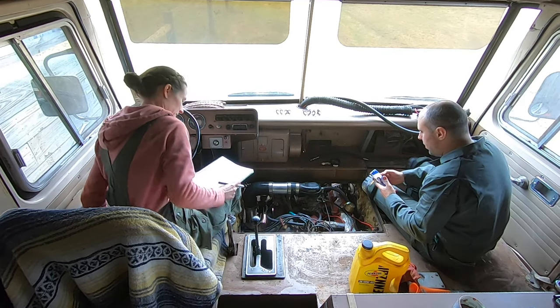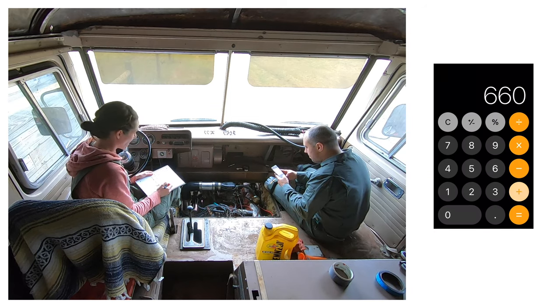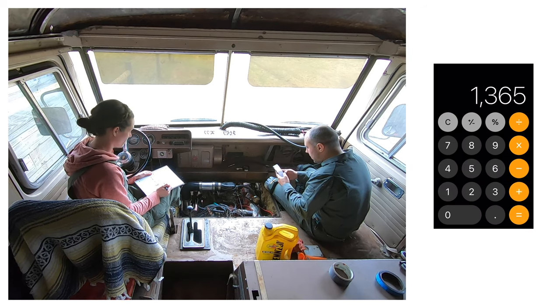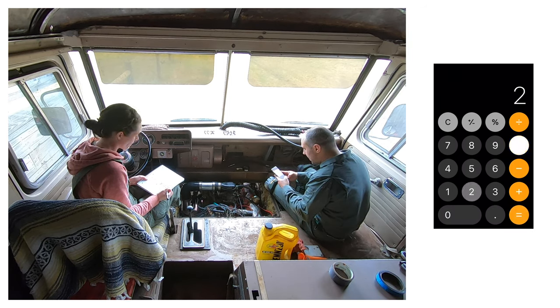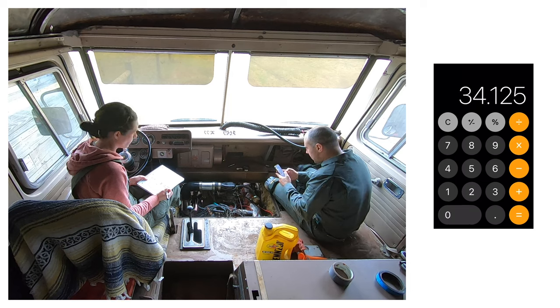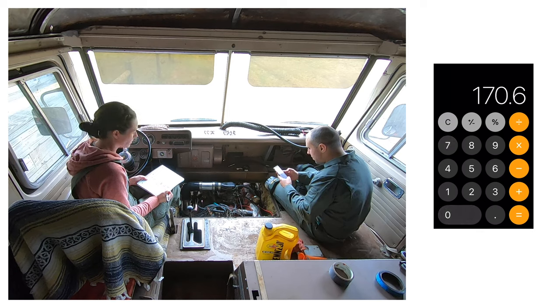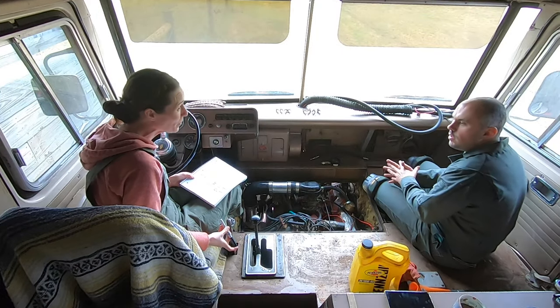Let's do a new average. The full wet results are: 190, 150, 160, 160, 195, 160, 185, and 165. The average is now 170.6, and 20% of that is 34. So the upper limit is 204 and the lower limit is 136.6. Everything's well within that — we have a super duper healthy engine.